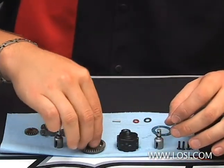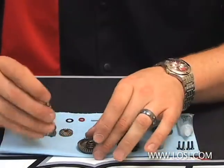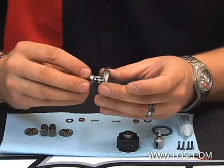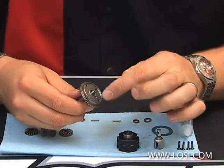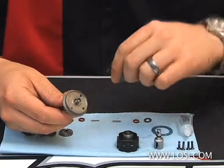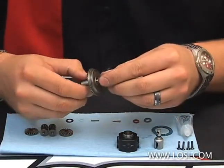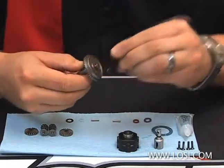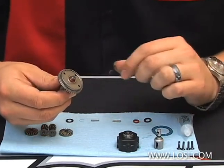You'll place your bearings onto the ring gear and the diff housing, and put the outdrive onto the ring gear. Work it around just to work the grease around. And you'll have some excess black grease here, and that's actually good because as you push the O-ring on, it'll kind of push that grease down there so that you have a good seal.